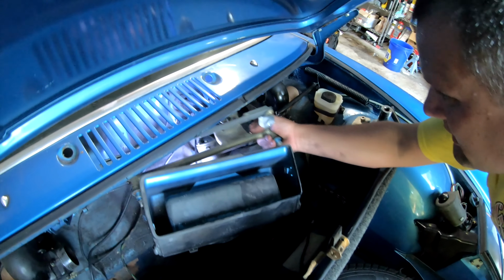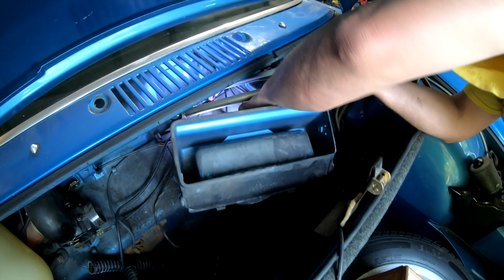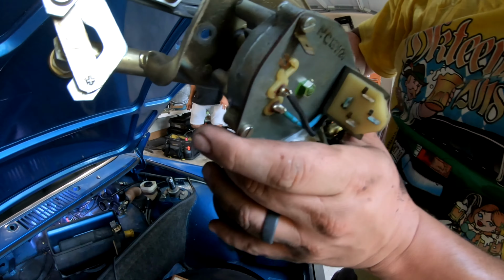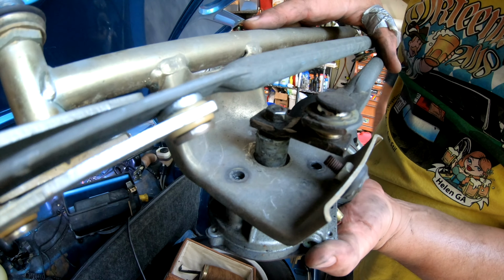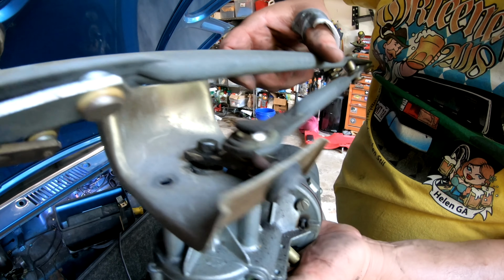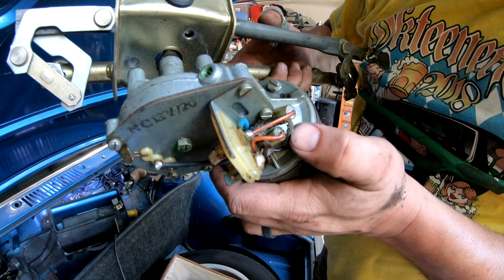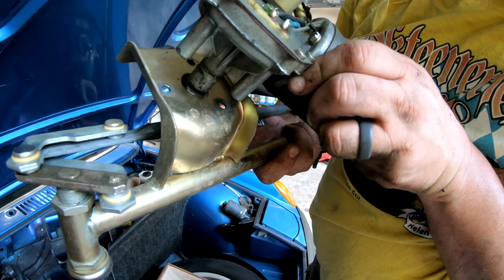They had washers. Success. So what the problem was, these bolts are gone. We found 2 out of the 3, and I'm guessing at some point they just worked their way loose. This came down, that bound up right there, and it smoked the motor completely. You can see a little bit of crusty on that wire, and it also fried the connections on the stalk.